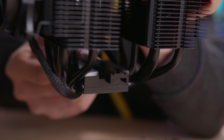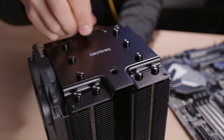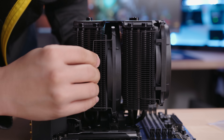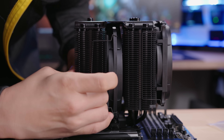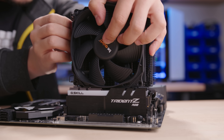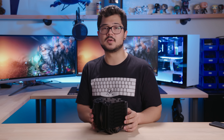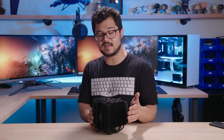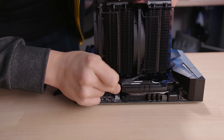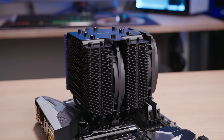There's a back plate you have to fasten to the back of your motherboard, and there will be four screws that pop up. You take four mounting posts, screw those to those screws, and then mount your CPU cooler onto your CPU with some thermal paste, of course. Next, you lay a single crossbar over your copper plate and prepare for screwing. There's one screw on either side of that crossbar, accessed by unscrewing two of the caps on top of your aluminum cover and using the included screwdriver to bolt them down. Afterwards, you can mount both fans using the included wire brackets — which are a bit of a pain to use and can scratch the special coating off the fin stack if you're not careful. If the outer fan is interfering with your RAM modules, the wire brackets do allow enough flexibility to lift that fan slightly for more memory clearance. Be Quiet also includes an additional set of brackets if you want to mount another 120mm fan to the other side of the heatsink. Finally, connect both fans to the included fan splitter and then to your motherboard's CPU fan header.